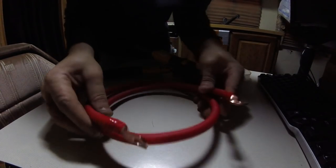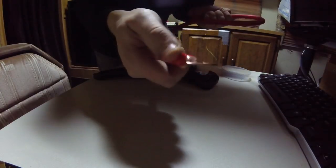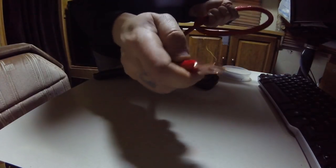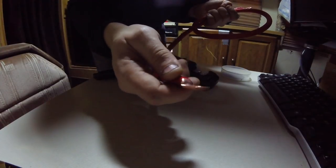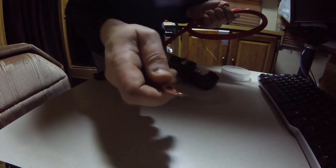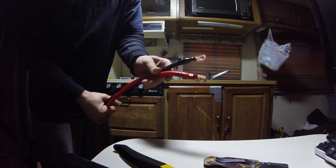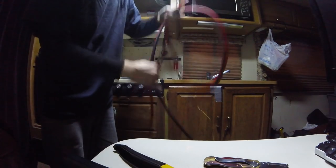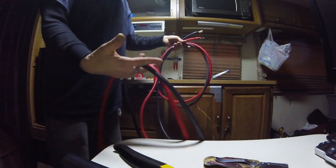First wire — I'm going to go from the alternator to the battery isolator. I'll put some electrical tape on there to clean things up and make the conductive surface area smaller, less likely to have something arc out across those parts. Got a couple of lugs on the remaining roll of wire, lugged up and taped. I'm going to run this down to the batteries, cut it off where I need it, and add two more lugs.